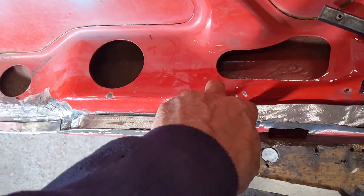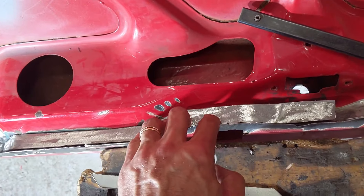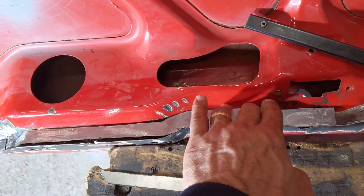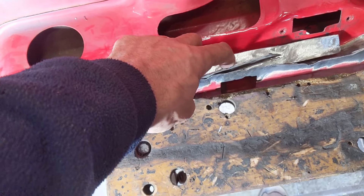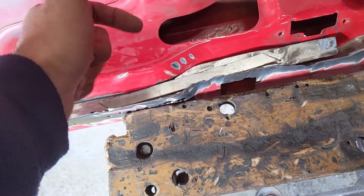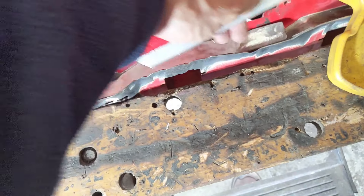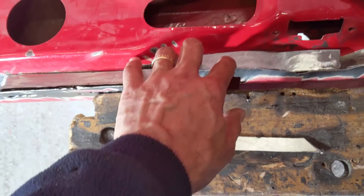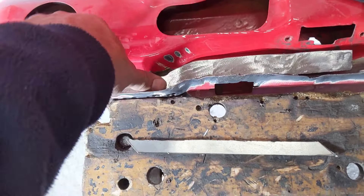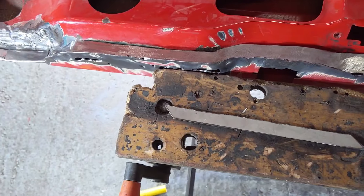This piece has a few bends in it, and I didn't quite have enough metal to get it all the way down. This sits in here and just at the moment needs pushing in to hold it in place. There's a bit of a twist here - I'll try untwisting that. What I'm going to do around this bit is bend this in and weld in a flange along here. We'll do this bit before the dip, and hopefully that will start holding this nicely in place without me having to hold it because it'll be welded together.